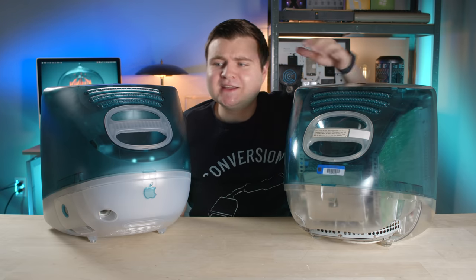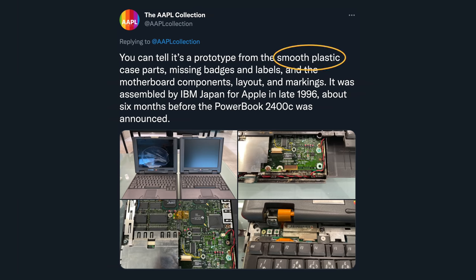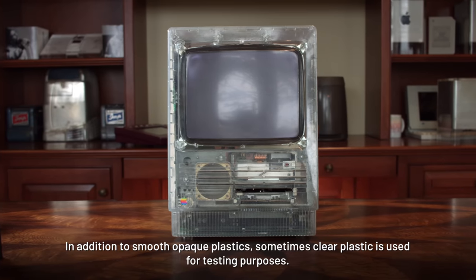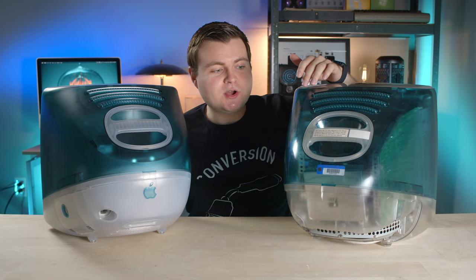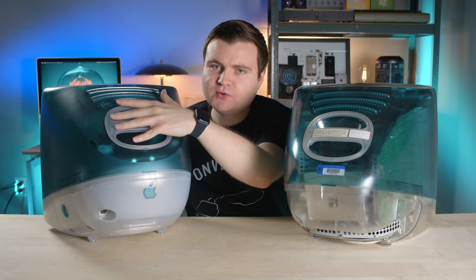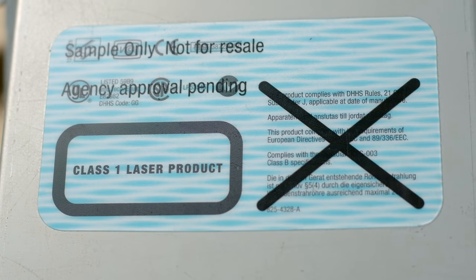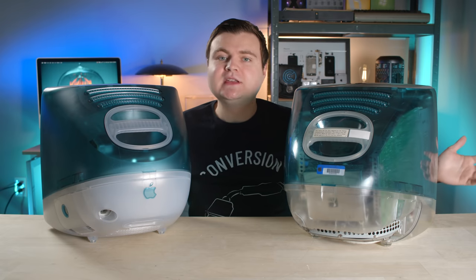The first big difference you probably noticed is that this iMac is extra shiny compared to the original Bondi Blue iMac G3 released in 1998. In a lot of Apple prototypes this is common — I'm guessing it's to save on manufacturing costs. The other thing you may notice is that it's a lot more see-through. There's more housings and probably some EMI electromagnetic interference shielding in the retail version that blocks the view inside. Because this is a prototype, it's pre-release hardware and doesn't need to pass FCC compliance, so EMI shielding is not necessary at this stage of development.